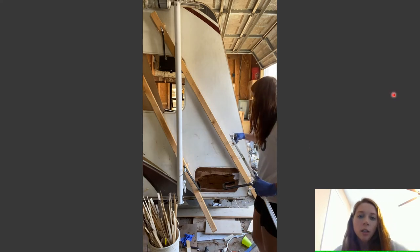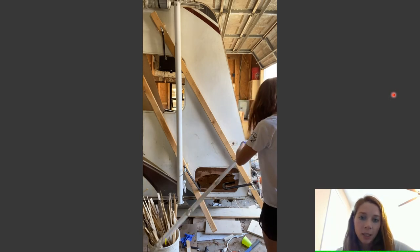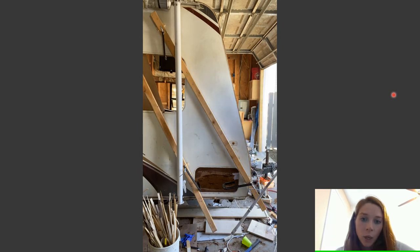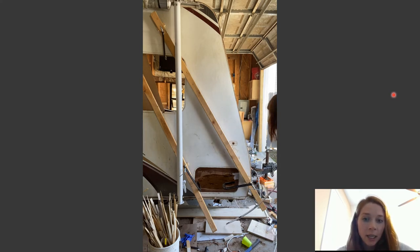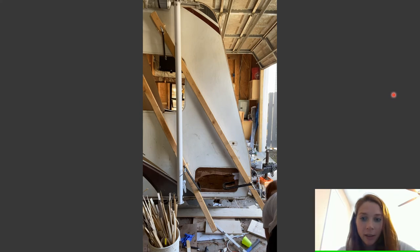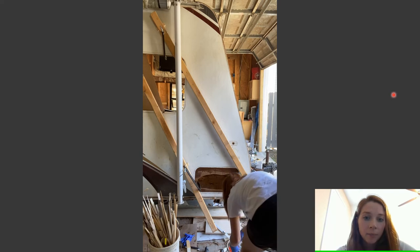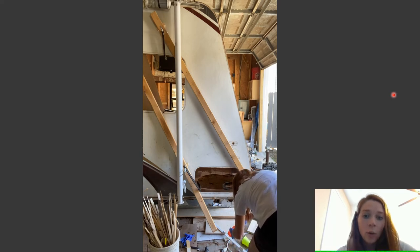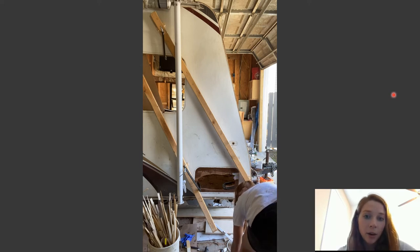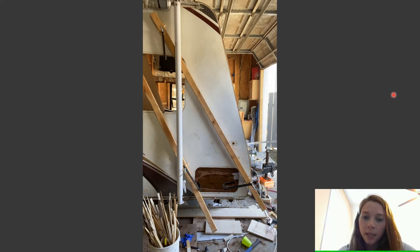Okay. So this is where the tubing and the trim comes in, and the syringes. What I did was I got a 60 milliliter syringe. I filled it with epoxy, and I attached tubing to a piece of plastic trim that I had. I just taped it on there. I think I used HVAC tape just because that's what I had. And then I stuck the whole thing in the wall of the camper, and I squeezed the syringe and slowly pulled it out at the same time.